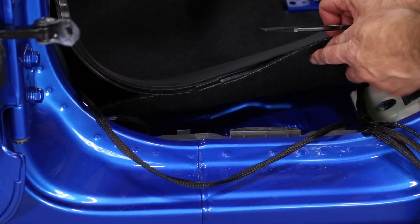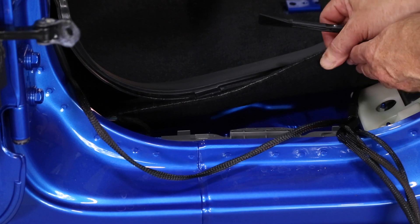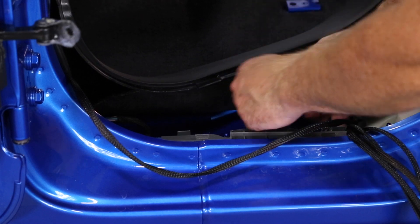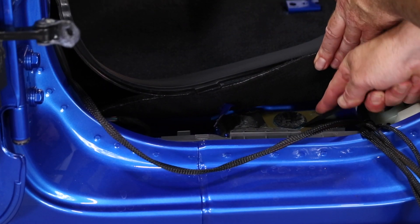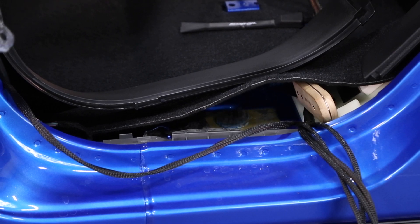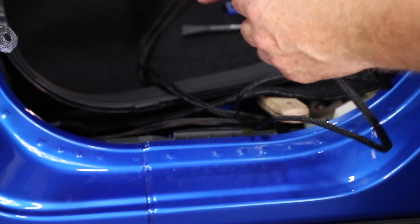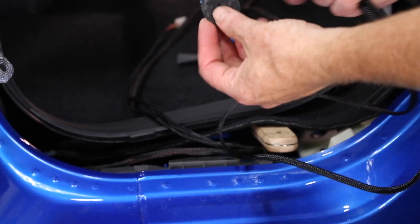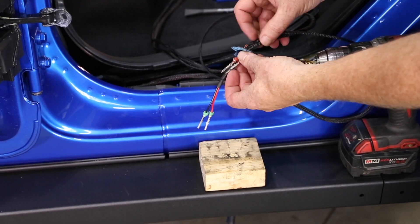Lift the carpet and you'll see a pad that looks like a large band-aid painted the same color as your Jeep. Use a trim tool to pry it up, then pop the plug out — if it's tight, come at it from below with a screwdriver and hammer. Once the plug is out, run two wires down through the hole. You can drill the plug out and put a small slit in it to work the wires through, then snap the plug back into place.